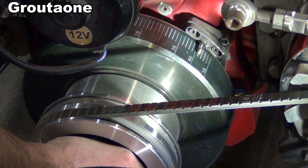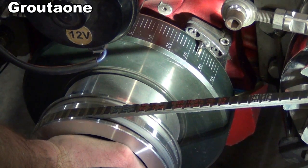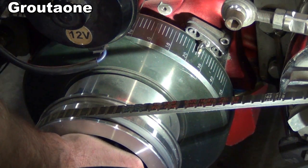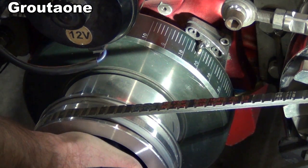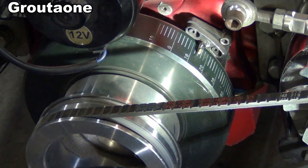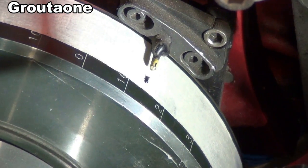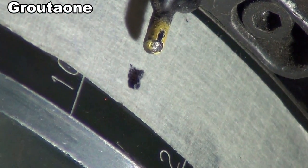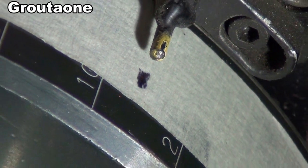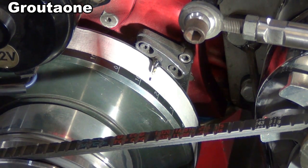I'm on the compression stroke here, so as I turn it pressure builds up and then I let it escape. I'll go a little bit more - sneaking up on the stop now, the piston is coming to the top and it's going to stop here soon. And there - hit that stop. While you guys weren't looking I put a piece of tape on the damper and then put a mark right where that pointer is at. That's the spot where the piston hit the stop.